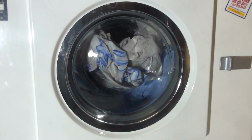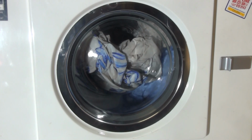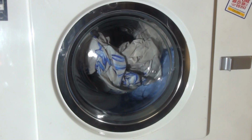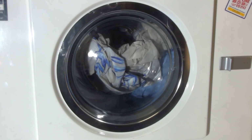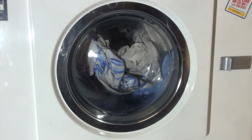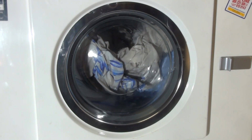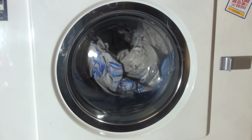They call it the micro hole drum, I think. Well, the whole point of the honeycomb drum was to have plenty of holes in it. Essentially, the honeycomb drum is Miele's version of the SpinCare drum from Servis. We say it was kind of inspired by that. And the fact that you've got to switch on power to the machine before you open it, Servis, I think, were the first to do that. Yeah, they were. And the fact you had to actually set it to the stop position as well. Because if you set it to program C before turning it on, and then tried to open the door, it won't release the door. It has to be on the stop position.